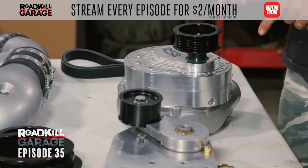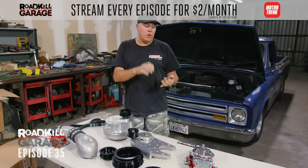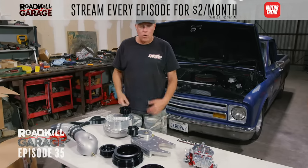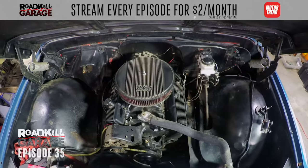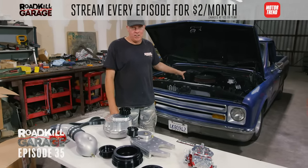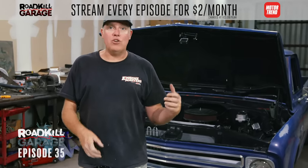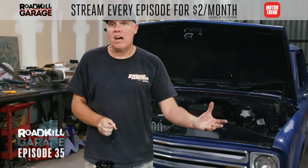On this episode we're doing a blow-through supercharger on the truck. The tech you'll see covers installing a centrifugal supercharger, how to blow through a carburetor, fuel and ignition modifications, and the gauges we recommend for the tune-up process. This applies to anyone using a centrifugal blower or even a turbocharger with a carburetor. The engine in the truck is a stock long block — really bad cylinder heads, tiny camshaft, only an intake and headers. The supercharger is a Pro Charger F1A-94; these things can make 1,250 horsepower.